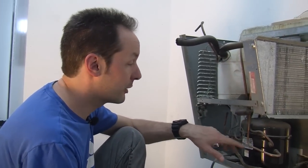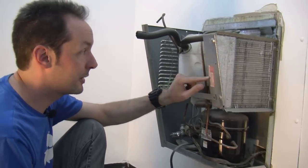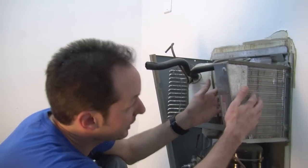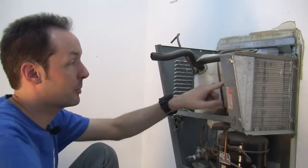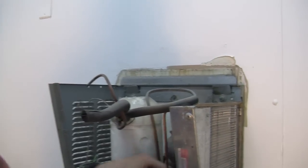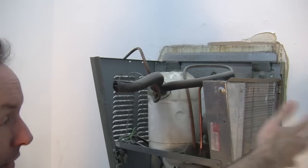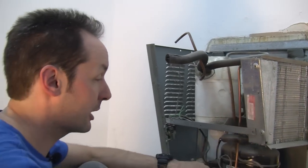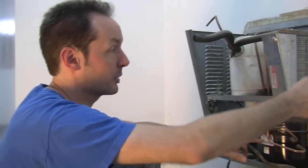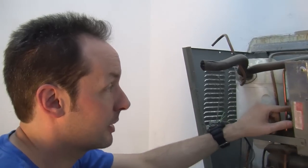Well, that heat first goes into here, and this is just a radiator where that heat is pushed out by this fan. So we're radiating away that heat through conduction and radiation and getting it out. So warm air comes out here, and that's the heat energy coming out from the mechanical energy we put in here. It's that energy, and we're getting rid of that. And as that happens, we now just have liquid in the pipe, okay?